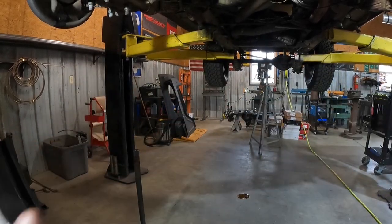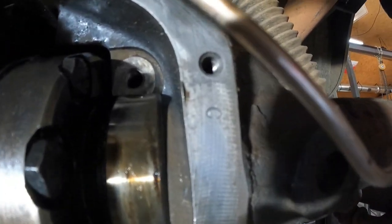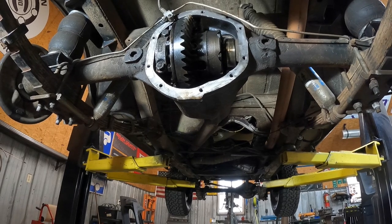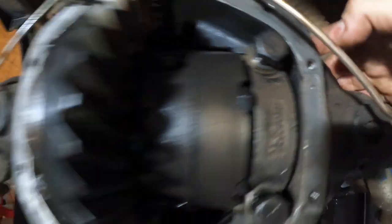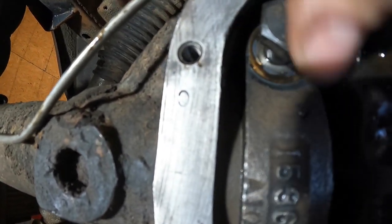You've got a C laying upside down on one cap, and then right here we've got a C laying upside down on the other. So we're going to align these two. Now you can see — C to C — making sure the bearing caps are properly oriented.